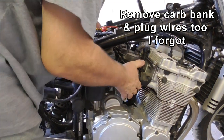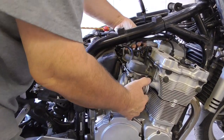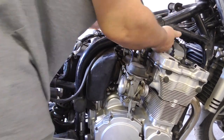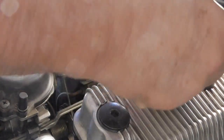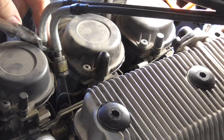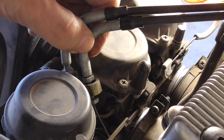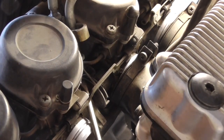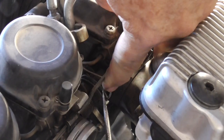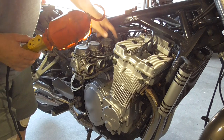I can sort of leave these off and start to move them right. I've got to sneak the throttle cables out — it's a little tight on the spark plug there. Undoing the top 2 nuts. Removing this front one first: you loosen the top nut all the way out, push it back and down and through the hole, and wiggle on the cable a bit. Lift the cable up — there's a lead bead on the end. I forgot to remove the choke cable too, so you've got 2 throttle cables and a choke cable to get off.